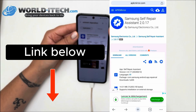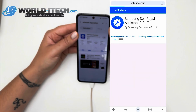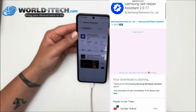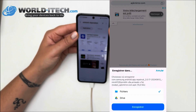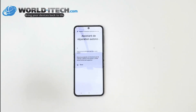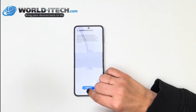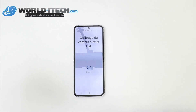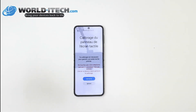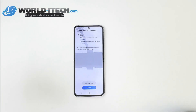If you can't find the app on the store, don't panic — I've provided a link in the description to download the app directly to your phone. It looks like this, so it's an APK which gives you access to the self-repair assistant, and then all you have to do is follow the instructions. Once you've downloaded the application, open it and select the screen you want to calibrate. Press next, then start the program several times. This will launch a first calibration, so all you have to do is wait. When this first calibration is complete, a second one starts — the screen will turn white. The screen is now calibrated; press close.